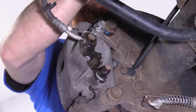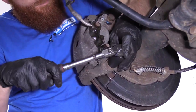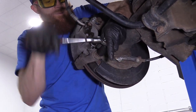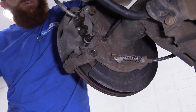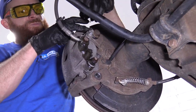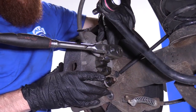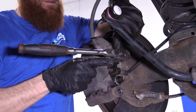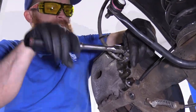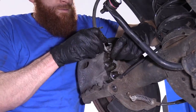I'm going to get this back out of my way. I'm going to come down here and give it a little love tap. I've removed that bolt — this bolt's still in. Now I'm going to go ahead and remove this completely and then drain my caliper into the receptacle bucket. This bolt's still in a little bit, keeps it from falling off completely. I'm going to remove the banjo bolt completely, let the fluid drain as much as I can, and then I'm going to remove this. Turning it to the left.